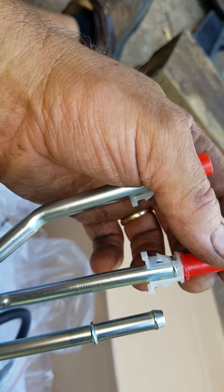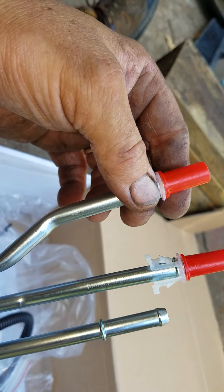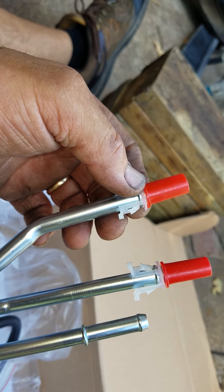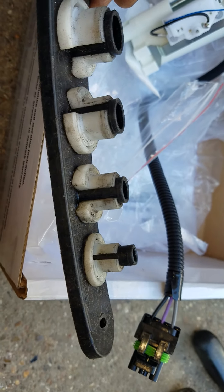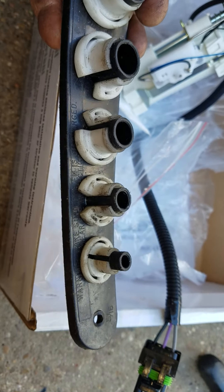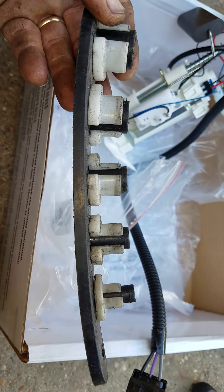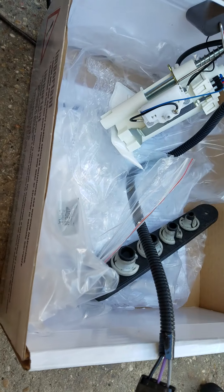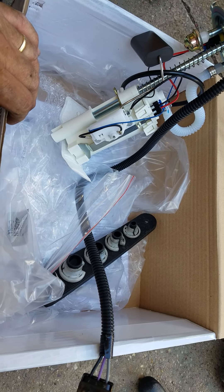I might need to change these two little fittings, or just take them off, because the hoses on there now are the type that have little wire-wound clips. You'll need a special tool for that. Usually what I do is shoot some WD-40 in there and blow it out with compressed air in case there's any dirt. Make sure there's no pressure in the fuel line — you'll have to go up under the hood and press the Schrader valve pressure release.